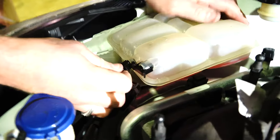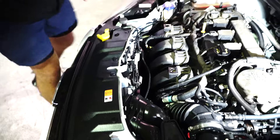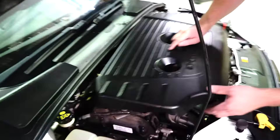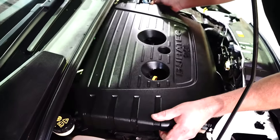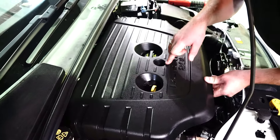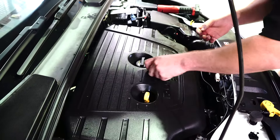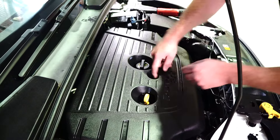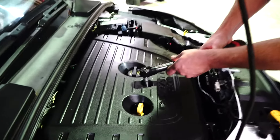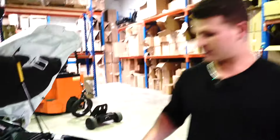Over at the tank, don't forget these clip in all the way along, keeping it nice and neat. Clip in — listen for an audible click, boom, there it is. Pop it back into its supporting clips all the way along, then cover on. Line up the three grommets to the three posts and bring the engine cover over. Having the oil cap in center is a good start. Use a magnet stick to lower the little 10mm bolt in — otherwise you have to bring it all back out. Once lined up, tighten it up — not too tight, otherwise it'll crack everything.